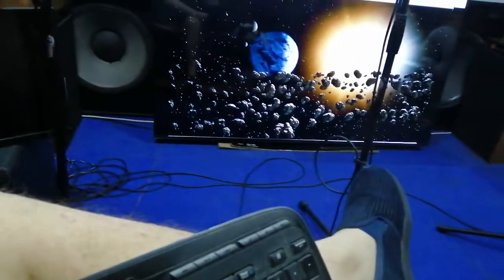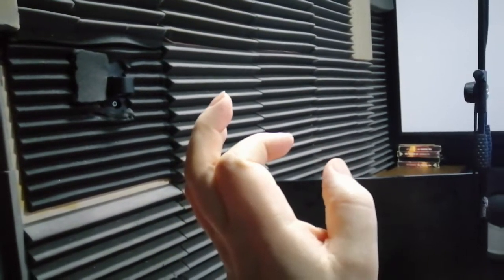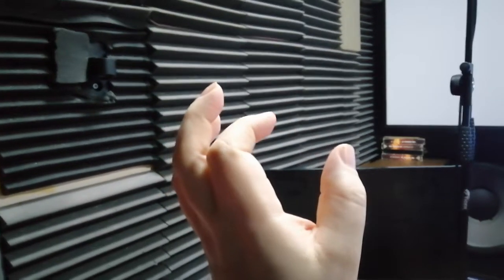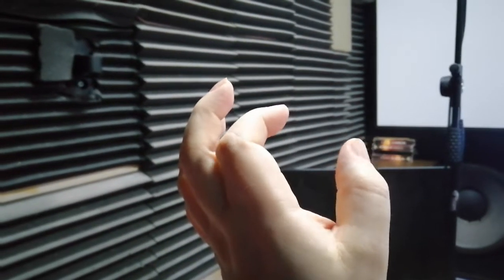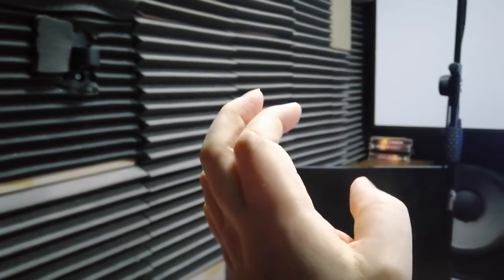So I've got Starship Troopers just playing in 4:2:4 matrix, but the problem is there isn't some sort of auto-azimuth. Auto-azimuth is an auto balance correction to balance the incorrect signal of a left total, right total signal. So if the forward plus phase signal, the center, was drifting over to the left too much, or too much over to the right, it would balance it automatically. Here it's just leaking out over to the left channel. It's just imbalanced.